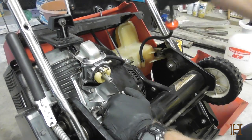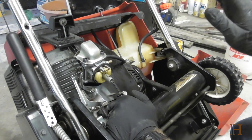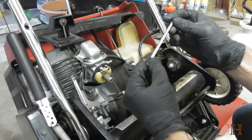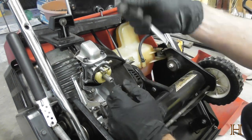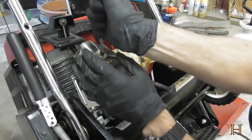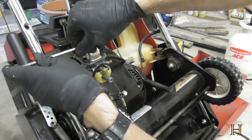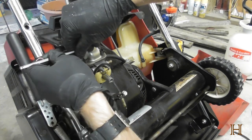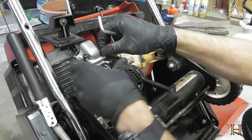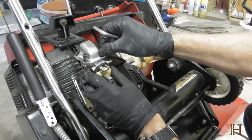To remove these is rather easy. You just remove the shroud and tip it on its front so the fuel can't leak out from what's still in the tank. You need a five millimeter Allen wrench and you've got to remove these two bolts here that hold the air shroud in place. This is also where the fuel goes from the primer bulb when you prime. Just crack those open — this is actually the only thing that holds it on physically with screws to the snowblower motor itself.